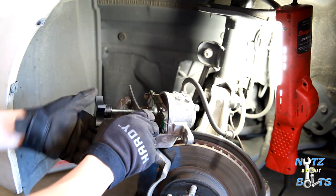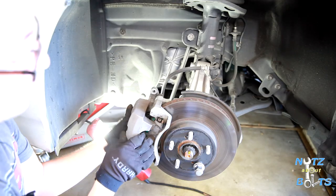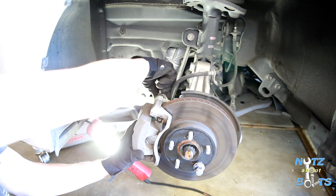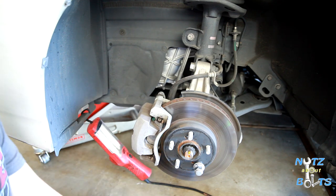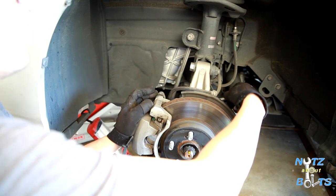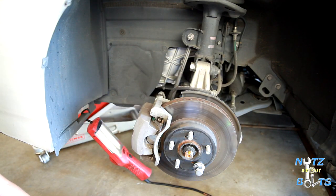It's all the way back in, so just loosen the tool. Now you can see it's nice and flush and you're ready to put it back together. Slide the caliper back on and put the bolts back in — torque those back down. Don't forget the brake hose — there's a little tab that lines up with a hole, so make sure that tab lines up as well, otherwise you might bend the little bracket. Tighten that down and it's all back together.